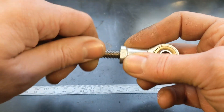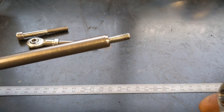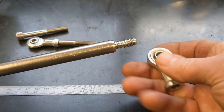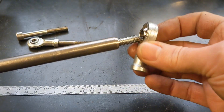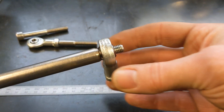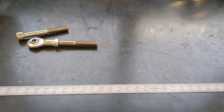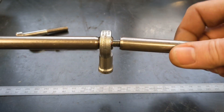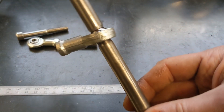The other thing I wanted to show while I've got the super special tripod out is how I've mounted this halfway up the gear lever. This is the gear lever which I've turned down and put an M8 thread on — it fits on there and I've put a little chamfer on it so it lines up with the ball and looks aesthetically nice. That's the other end of the gear stick — it's been drilled and tapped M8 and traps the ball. When the gear changes on the bike it looks like that — all in stainless, very nice.